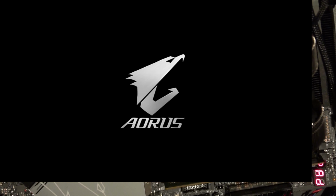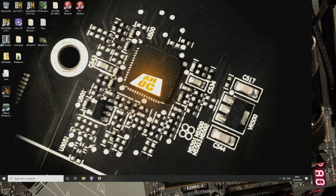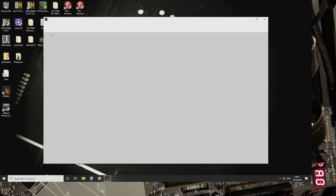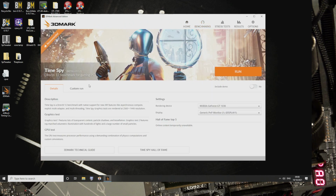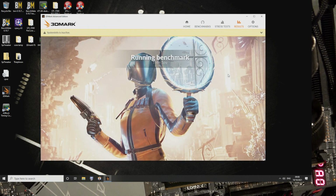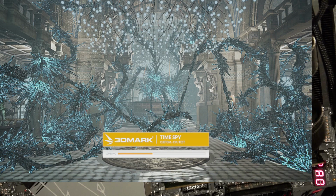Okay, so 26... Oh, no. I wanted to keep tightening it up, but oh well, we'll take this. Thing is, I guess we could run a quick benchmark to see how 26 compares to 28 on the TRCD, but I don't expect too much of a difference. We're still talking about a 10% reduction in TRCD, which is one timing. It is probably one of the most important timings there is, but it is just one of them. And 10% is not much of a reduction, so I don't expect to see some huge performance uplift from that, but...